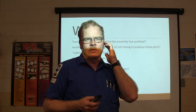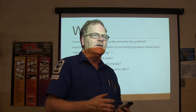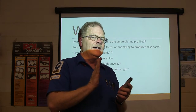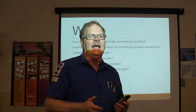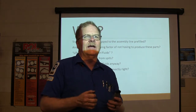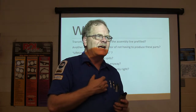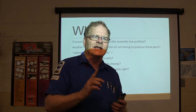And I've actually done that before too, whenever I'd have one with chattering and stuff, because when a torque converter modulates in, it's not a straight lockup every time. It's going to go 20, 30, 40, 50, or 60. The first time I ever saw that was in 1989 on an Eagle Summit. It had an engine surge. So I'm driving it down the road trying to figure out why it's got an engine surge. What's so stupid about it was I actually cleaned the injectors and cleared it up. Then it came back a couple of days later and was doing it again.